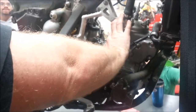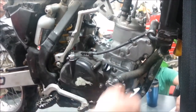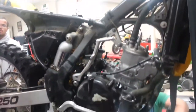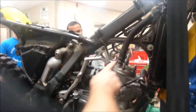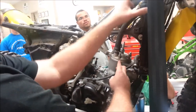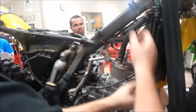On this particular setup, we're taking our radiators off because we want our engine. Of the two places here, what would be the better one to take the hose off? Off the motor — thank you. Do you have to take the radiators off to get that motor out? On this one you do because there's no clearance; when you're trying to lift it up, it'll hit the radiators. So we're going to remove our radiators for good practice. The pump runs coolant up through the cylinder, out from the head, and then back into the top of the radiators. Then they run back down, we remove the heat from it, and the cycle repeats itself.